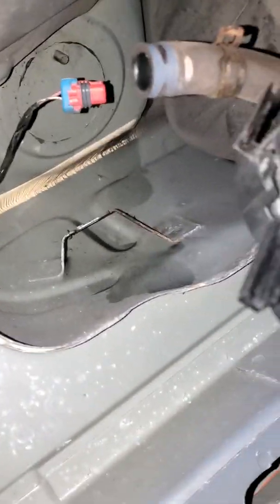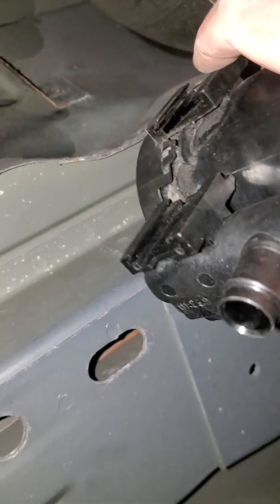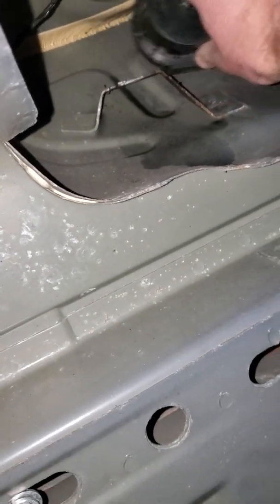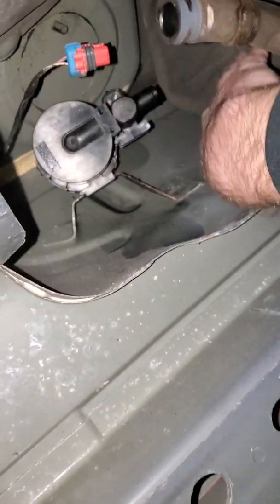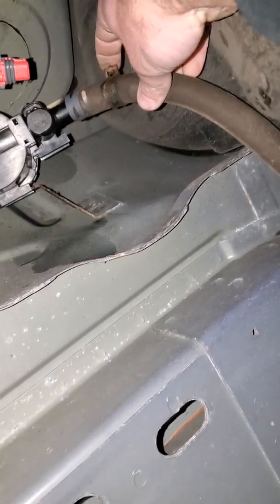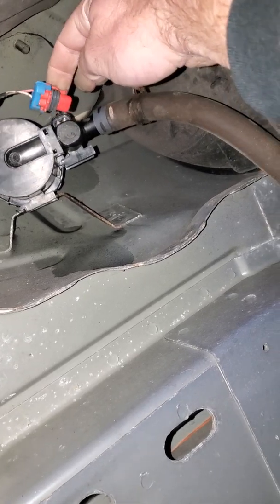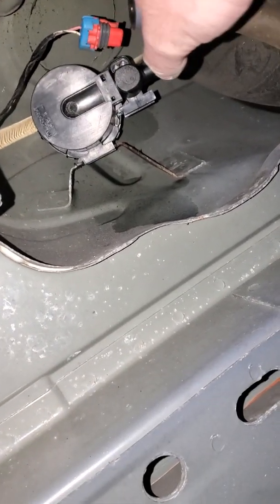This was actually a pain to get off, but I used some silicone spray right on here while it was up there, because it's been on there for a hundred thousand miles with all kinds of dirt and crap keeping it on. The silicone spray helped loosen it and let me push it out towards the front — so to get that off you push it towards the front. This hose goes on there and you just have a little clamp connection to connect, and then this plugs right up into the actuator. That actually came out real easy — I was surprised; I thought I'd have to spray that with silicone too.